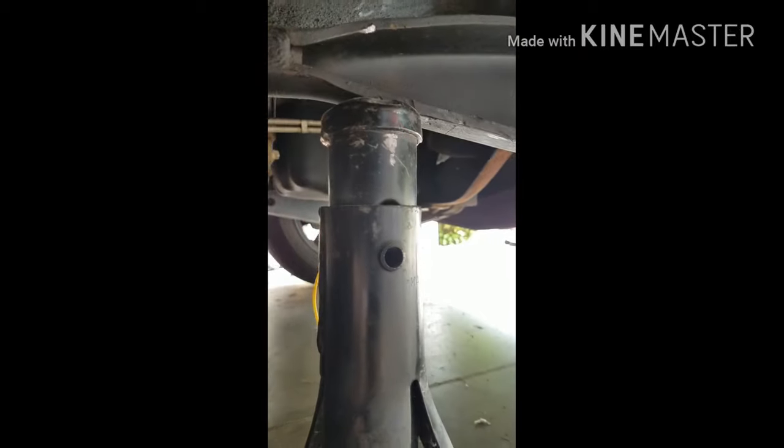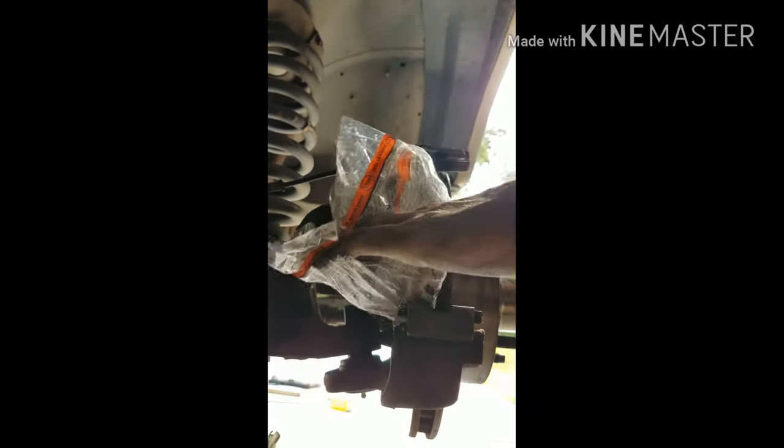Next thing, the stuff that we bought. It's over there somewhere. I'm just going to use the same one because they're still in here. So this is basically, they call it ceramic extreme brake lubricant. It's anti-seize, is what I've heard it been called. You want to basically put it on the spots that the brakes are going to slide up and down on. Try not to get it on the actual cylinder thing. I'm just putting it all over it.